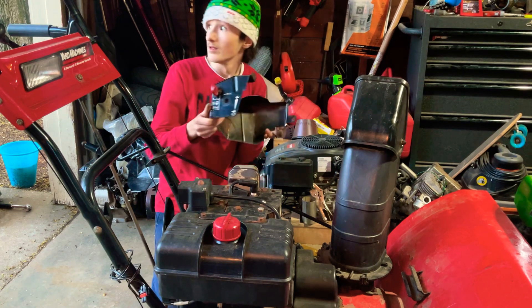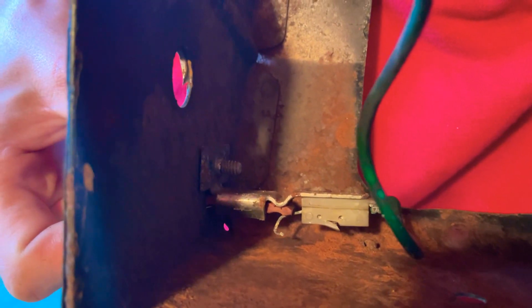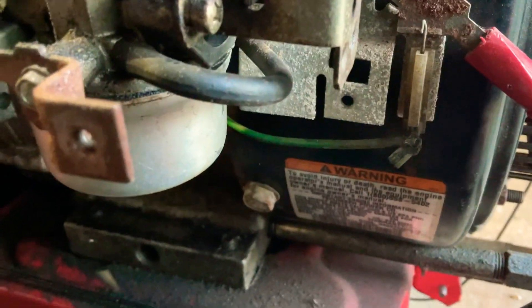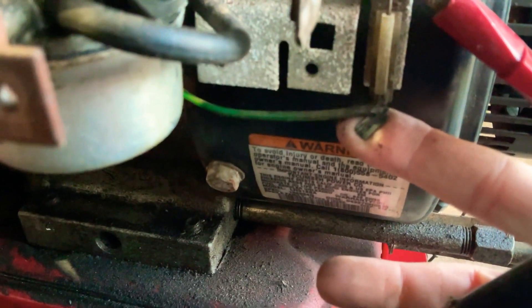If you're wondering how the safety system works on this thing, it's pretty nifty. It's got this thing right there. You can see how it works now — you've got a little spring that pushes down on the key when you pull the key out. It shuts it and it touches those two outer pieces of metal together, not the red piece of plastic. Sending a circuit down to this little wire right here in my hand. And that little wire attaches to the kill switch right here, and here's where your throttle assembly is — it attaches right there.